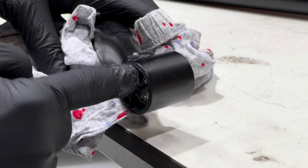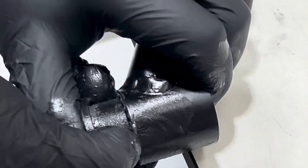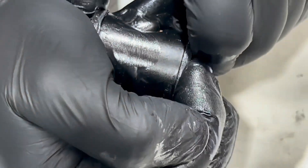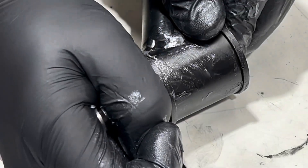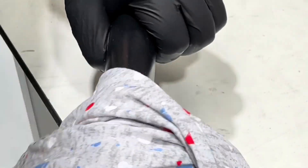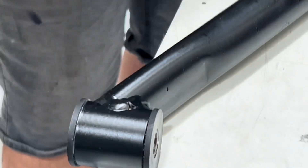This video is going to take you through the installation of your front suspension and your shock absorbers. You will need to firstly remove any powder coating from your arm loops. Then, using lithium moly grease, insert the bushes into the arms and insert the metal sleeve — sometimes these need a bit of persuasion. Wipe off any excess moly grease.